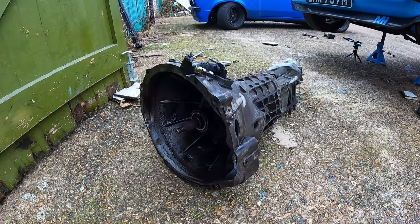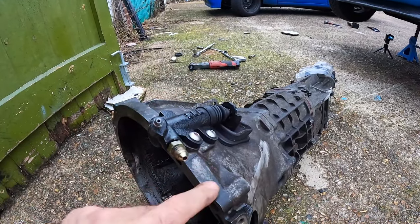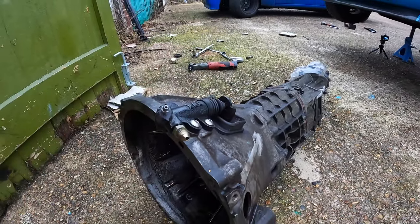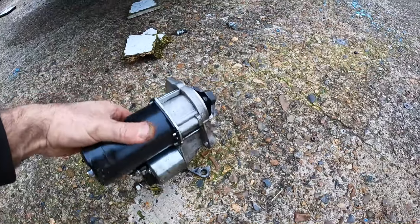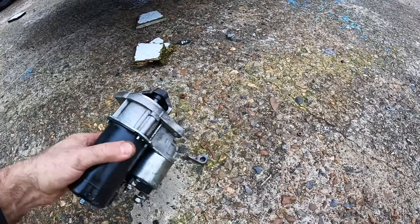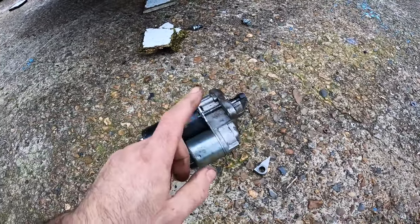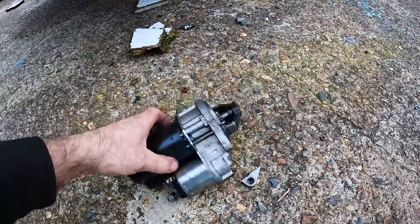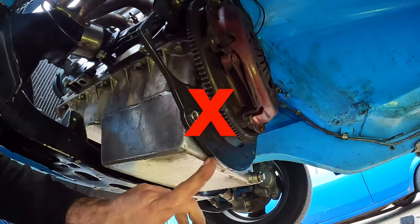That's Esther's Mazda six-speed out, although I can only take part of the credit - gravity did the last bit of work. It's much easier disconnecting this line rather than trying to take the slave cylinder off the box when it's in situ; these bolts are really hard to get to. The only downside is you need to bleed the clutch when you put it back together. I can't believe that the starter motor broke and I can't believe how far out of correct position it was - there was a massive gap. This is definitely my fault because lazily I only used two of the mounting bolts.